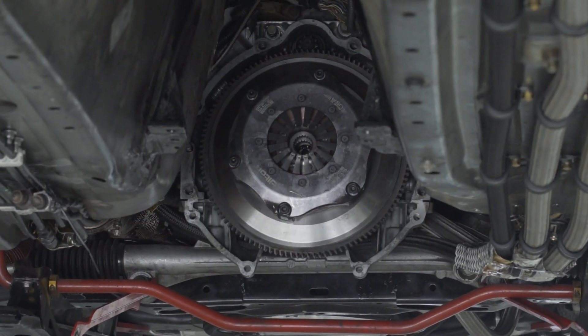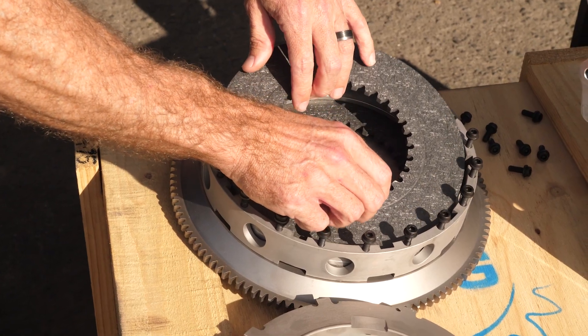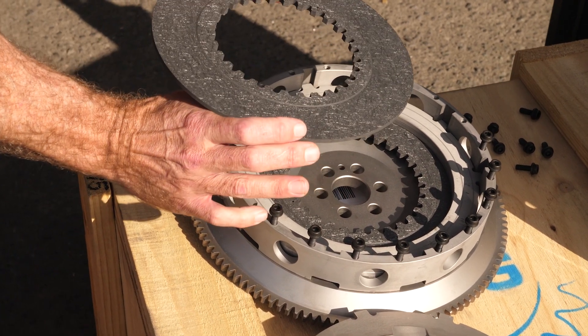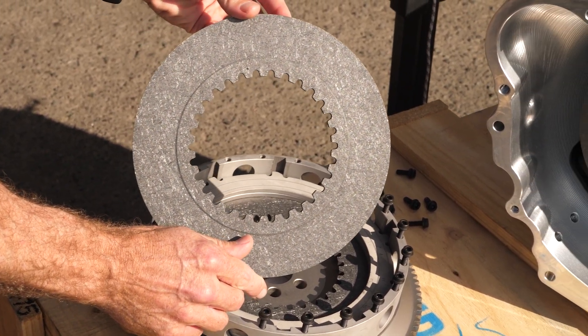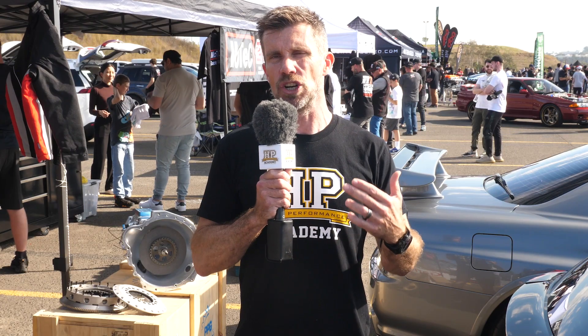So it's really important to consider the material your clutch is made from. One of the ultimate solutions is a carbon-carbon clutch, where the friction material is carbon as are the floater plates. This material is very good at handling high heat, which is generated when you're purposely slipping the clutch. It is also very friendly to drive in terms of grip — it doesn't tend to bite, making it easier to slip as you're getting the car off the line. The carbon material also doesn't tend to wear as much. These are some things you need to consider when shopping for a replacement clutch.